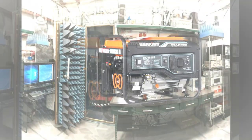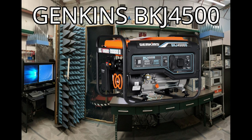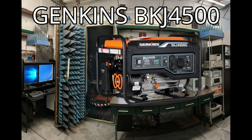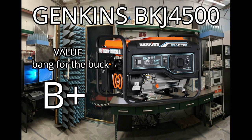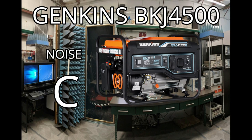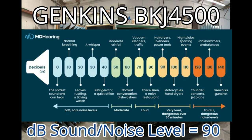Here's my evaluation scorecard for this purchase. Power output — I was impressed, A. There was very good power output on this generator. Setup and usage — it was a little bit clumsy, I'm going to give it a B. Value, bang for the buck — B+. I paid budget pricing for this generator and I feel like we got a pretty good deal. Durability, best estimate — C+. I didn't get the feeling it was the best-built generator. Noise — C. I was very disappointed with the noise, as it was much louder than the advertisement had claimed. Overall rating — somewhere between a B-plus and an A-minus. A little bit about decibel noise levels: they were claiming in the advertisement it would come in around 60, however I found it more to be around 90, which is a significant difference in decibel ratings.